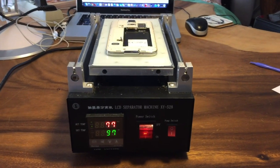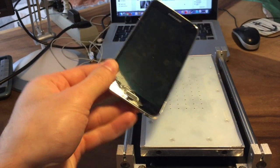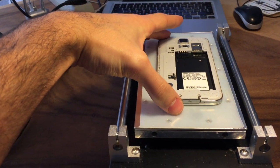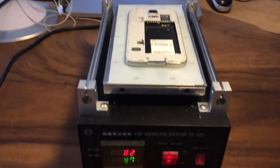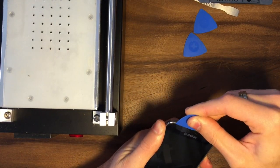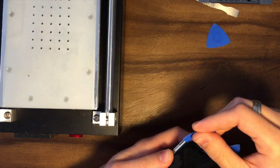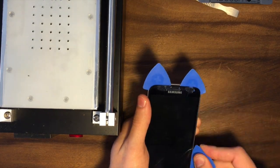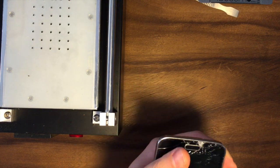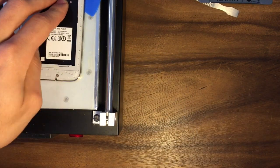Now the purpose is to detach the LCD screen block from the frame of your phone. What you have to do is to apply nice heat on your LCD — here I'm using a vacuum at 97 degrees. You have to be very gentle and enter with some pick so you will not crack your LCD, otherwise you have to buy another one and it's really really expensive. There will be some parts of the LCD really hard to remove, but you have to keep calm, put some heat and take your time.